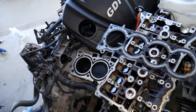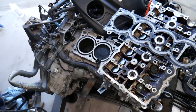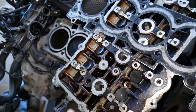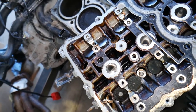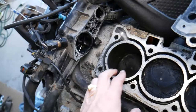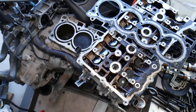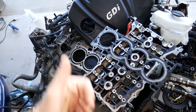Another cause could be a defective or cracked cylinder head — especially a crack on the bottom side near the combustion chamber — which can also cause bubbles in the cooling system. And in some cases it could be a cracked block, though that's less common. Hopefully this video was helpful for anyone needing that information. Thank you for watching, and see you guys next time.